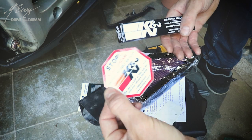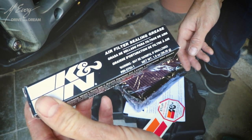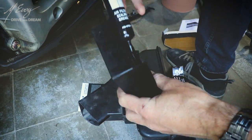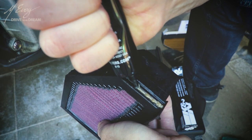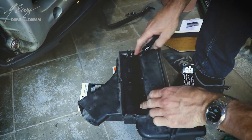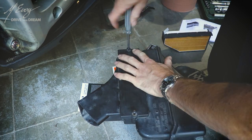This little sticker here you leave on the air box so that you don't throw the filter away. There's also some air filter sealing grease — basically just some grease which you lay a bead down on the contour of the whole air filter before slapping it back into the air box and screwing the cover back on. It's as simple as that — piece of cake.